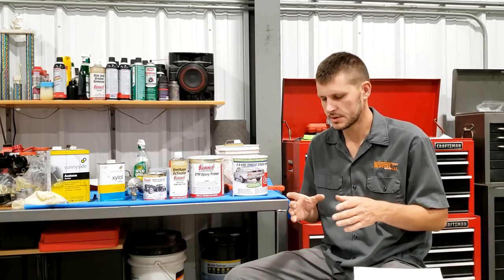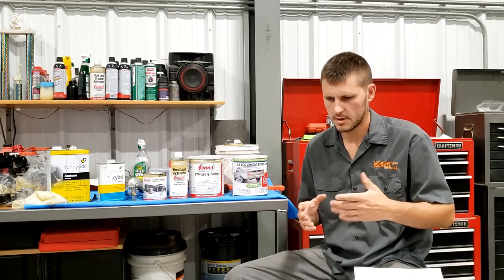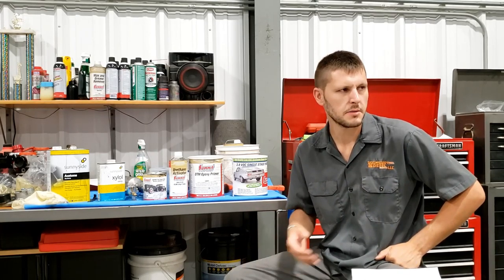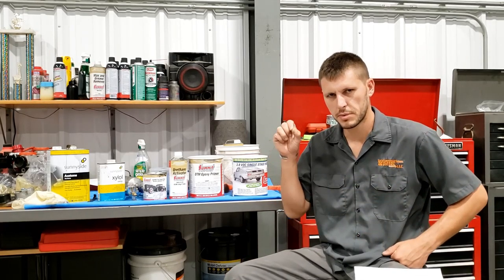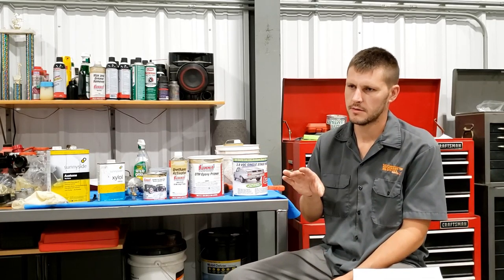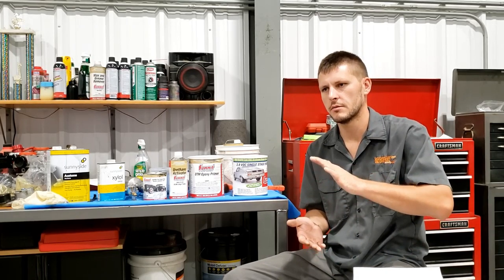And then lastly, and I've seen this on several different pickups with Line-X applied to them, Line-X is just a rubberized coating and it doesn't necessarily stick really well to metal or to paint. It sticks really well to itself. And so it's kind of like powder coating in that regard. Moisture can absolutely get between the metal of the frame and the Line-X. And it sits between the Line-X and the frame and it rusts out. And so that's actually happening in my Toyota right now. I got moisture in between there. You can poke a hole through the Line-X and water comes out. And so it's a great impact resistance coating, but you have to have something that's absolutely going to permanently stick to your metal frame and not allow water to get between that layer and the metal.